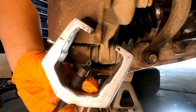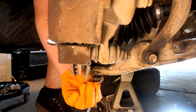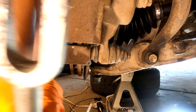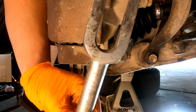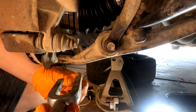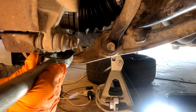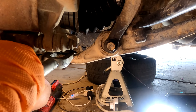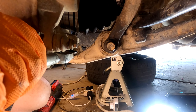To split the ball joint you can first try the tool — that didn't work for me. If that doesn't work, you can screw the nut all the way up and use a hammer. If not, use this fork, which is what I had to use. It tears the boot on the ball joint, but if you can't get it off the other ways, that's the only way to do it. There's a link in the description to buy this tool and a couple other ball joint separators.